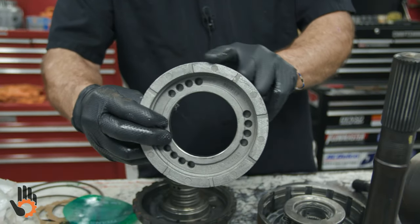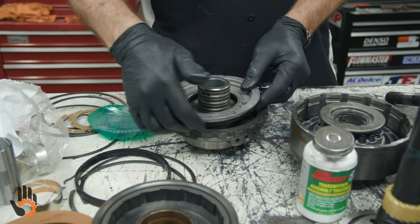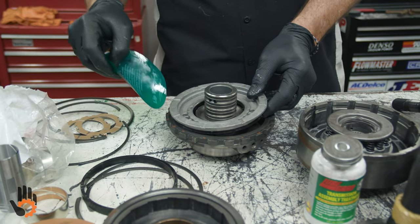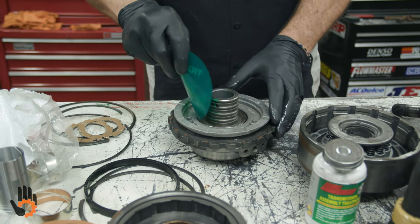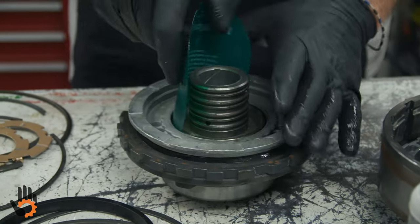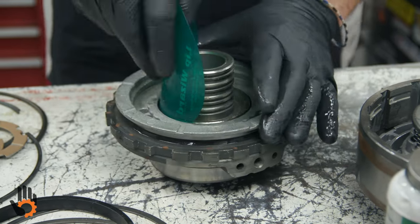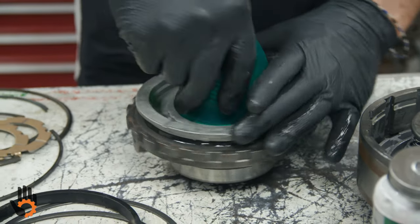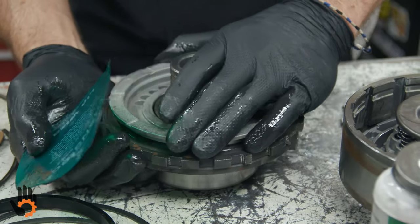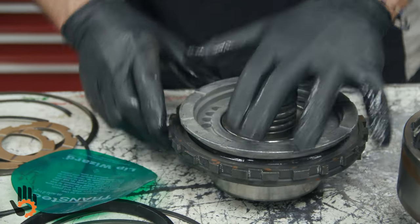You see the lip on this piston itself. So when we're installing this, we can't work that outer seal. It's kind of tough to get to, at least with this thing straight down. You could try and get it from the edge. Usually, if you work the inner seal in first, once again, a little bit of pressure on the piston. Sometimes I rotate it a little bit. Usually, now my hand's so slick I can't get it turned. Usually you can get that to drop in there.